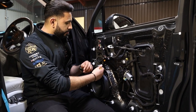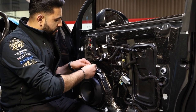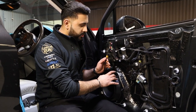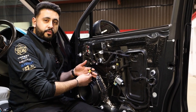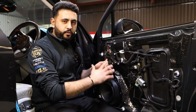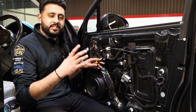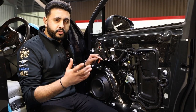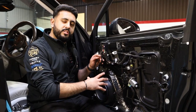In terms of the actual cable run, we're using connections-grade cabling, and we've also got these little connectors here — these connectors can't go wrong, it's literally one in, one out, and it means everything is nice and safe. The original connector that was on factory speakers and different components — manufacturers are used to using connectors like this — so it's very easy and obvious to see that the speaker can be removed without having to damage anything we've installed. In terms of the component inside this door, this is the Hertz Mille Legend 1800 — a seven-inch woofer that provides a lot more mid-bass into the vehicle. I'm going to hand over to Carl, who'll talk about the actual adapters we've built to house these speakers into the vehicle.